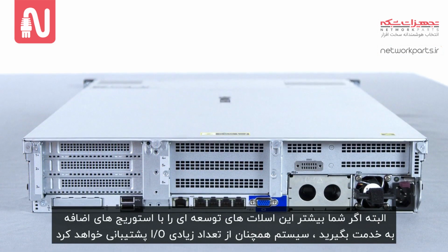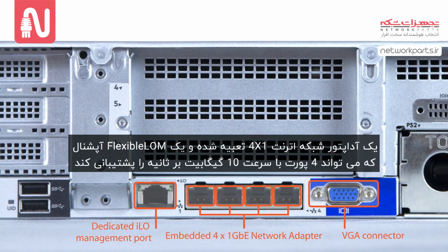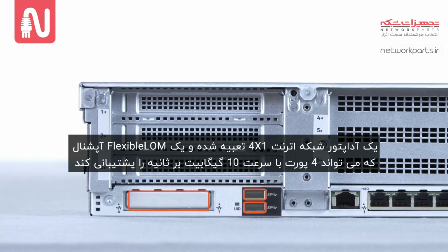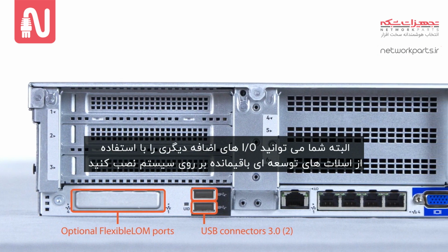Of course, even if you do take up most of those expansion slots with additional storage, the system will still support massive I/O with an embedded 4x1 gigabit Ethernet network adapter and an optional flexible LOM that can support 4 ports and 10 gigabits per second each. Of course, you can also install additional I/O by using the remaining expansion slots.